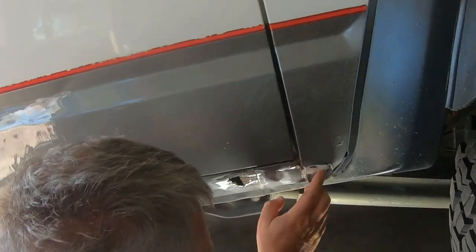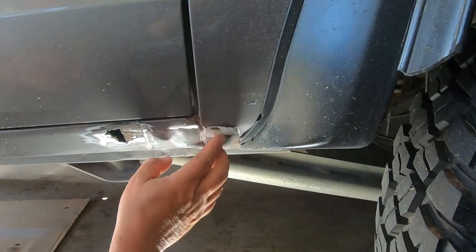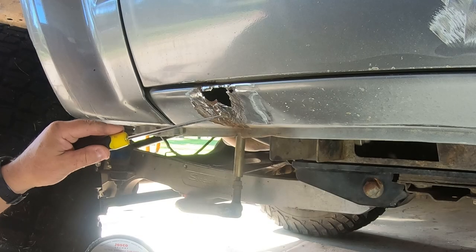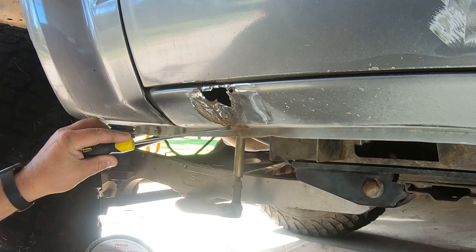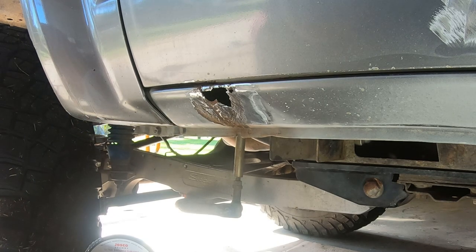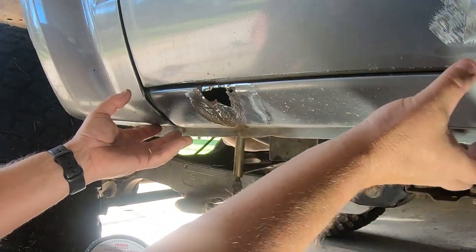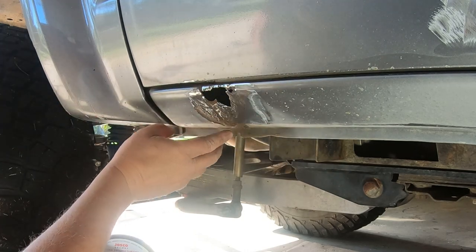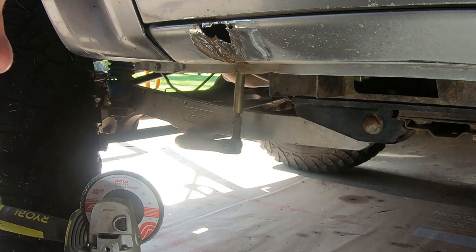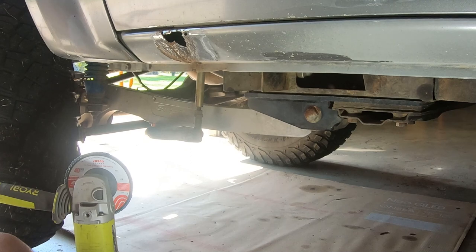That's all bondo. Bondo? Yeah, it had some in the rear quarters when it got chopped too. This sill is welded over top of the A-pillar. That's the A-pillar there — this is part of the A-pillar or part of the front of the car. So it looks like that sill slides. They probably go along and spot weld the whole thing in. But like you said, the sills don't actually look like they've been hit.